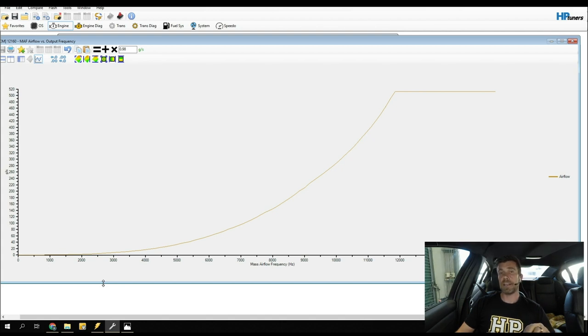A question I often get asked: are we going to get absolutely perfect values with no error at all? The answer is no — that's unrealistic. I'd like my error to be no more than plus or minus one or two percent, with plus or minus one percent ideal for wide open throttle ramp runs. You've got closed loop control and narrow band feedback at idle to pick up small errors. At idle, fuel trim errors between zero and plus or minus 3–5% are generally indicative of a tune that's not too bad. If you're sitting at 10% error or more, there's definitely work to be done.